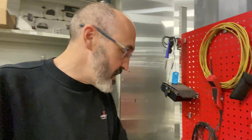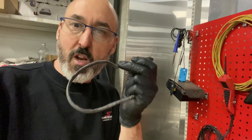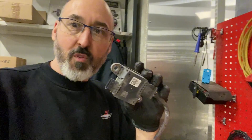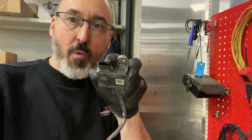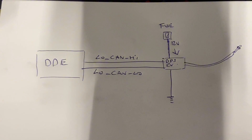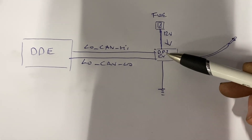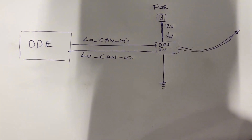On the Ben Johnson Diagnostic Fault Finding Channel, what I'm teaching you is: when you get a fault with something like this - I've got a video about oxygen sensors, you can go look at the long videos for that - but when you do get this fault code you need to check, even when it says the sensor doesn't work or there's a short, you still need to check the wire into the sensor. One of these days I'll get one where the wire will probably be broken. Amazing diagram, but don't worry - all that matters is you understand how it works. There's the probe that screws into the exhaust, there's the cable, and the harness connector.